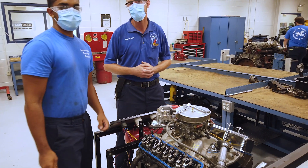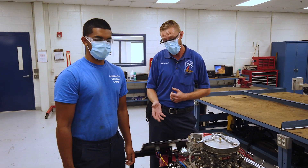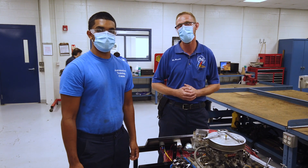We make sure that the engine's at top dead center on the compression stroke for any cylinder that we're adjusting. So at this point he would be able to do the adjustment on the intake valve, and that's how you do an adjustment on a solid lifter.